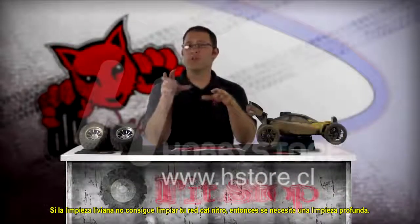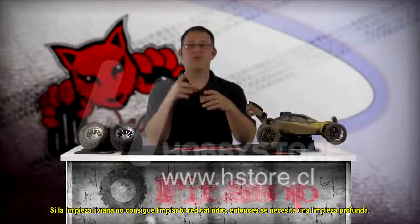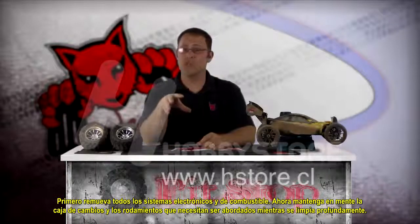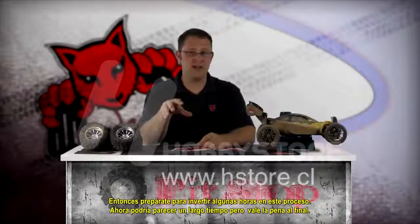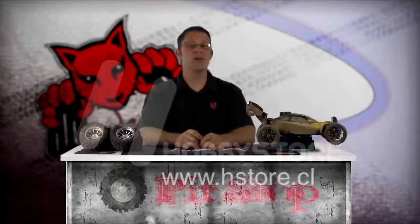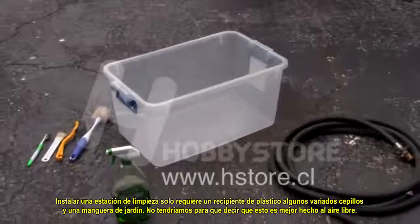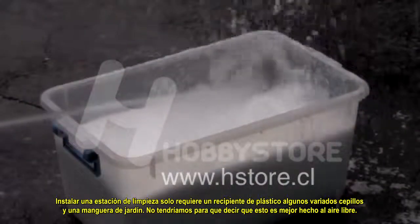If light cleaning won't get your RedCat Racing Nitro vehicle clean, then a deep clean is in order. First, remove all electronics, engine, and fuel system. Now keep in mind, the gearboxes and bearings will need to be addressed while deep cleaning. So be prepared to invest a few hours in this process. Now it may seem like a long time, but it is well worth it in the end. Setting up a cleaning station only requires a plastic bin, some assorted brushes, simple green, and a garden hose. It should go without saying that this is best done outside.